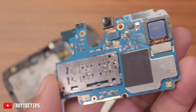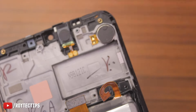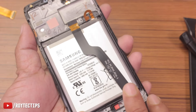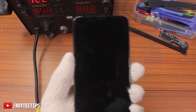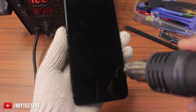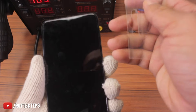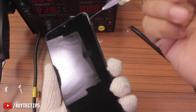Here is the front camera — it's incredible how humans can make such sophisticated things. This is the front speaker and this is the vibration module — it's glued to the frame so I'm not going to remove it. When changing your own display it's better to remove the lithium-ion battery since it's flammable and too much heat can cause it to catch fire. I think I can manage without hitting the battery directly. Now we're going to heat this display to soften the adhesive, heating to around 120 degrees.